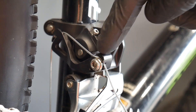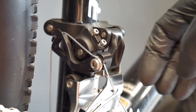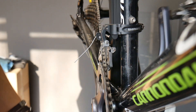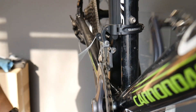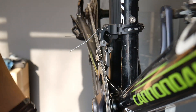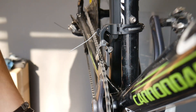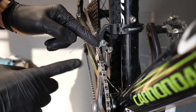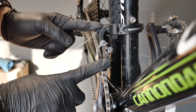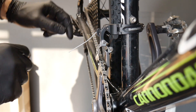If you route the shifting cable like this, it seems to be okay, but the front derailleur doesn't go all the way up and down as needed. Just take a look at it. In this way, the chain will wrap against the front derailleur when we have the chain on the big ring at the front and maybe the last fourth — the fourth highest gears on the cassette.